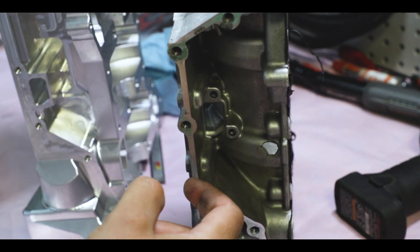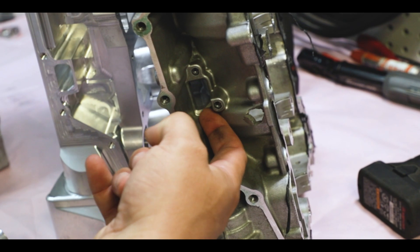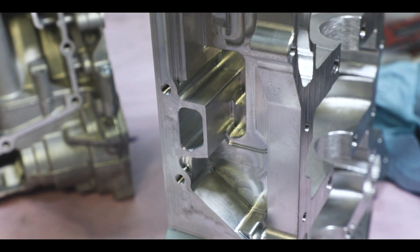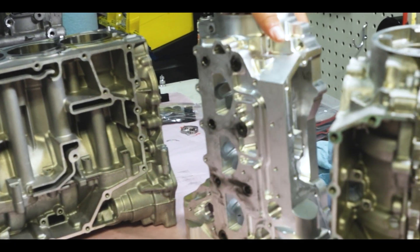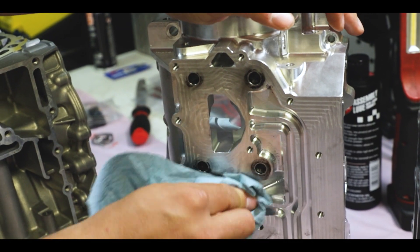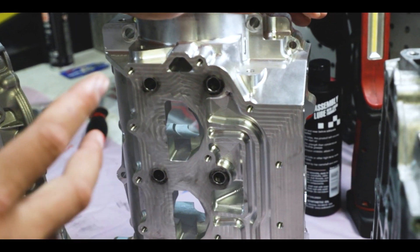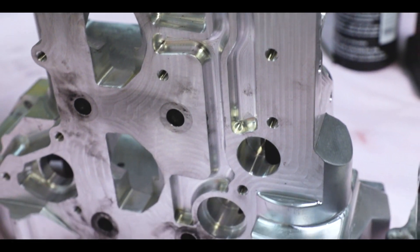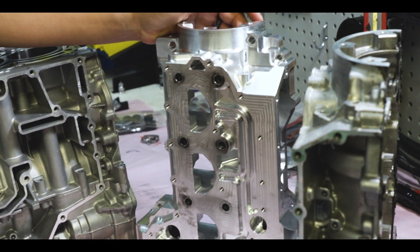The issue with the factory plastic oil pickup piece is that if you make a lot of power and all that oil pulls off, you can suck in air behind the bottom of the pickup. So we decided to make that a part of the girdle — it's just one piece now, basically 100% strength. This girdle has been machined to a block, which is why there's moly all over it, but it's solid structure. All the oil paths are still there, everything bolts on perfectly. It's made out of 2024 aluminum — at least 40% harder material than the factory girdle. All the power transmitted through it isn't going to deform; it's going to keep that block nice and strong.